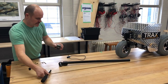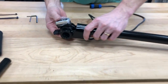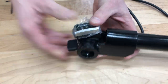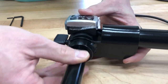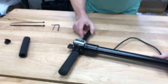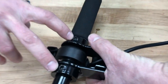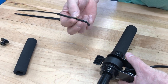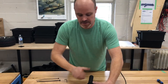The throttle wire goes underneath and in the center between these two bushings — hold it there. Your T handle goes through the hole, works like that. On the backside you'll see there's two big set screws and they take the four millimeter Allen wrench, but before we put that on we're gonna get our other foam grip on so it's centered up nicely.